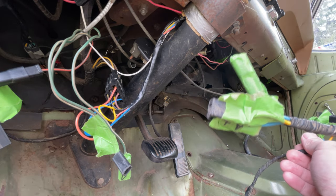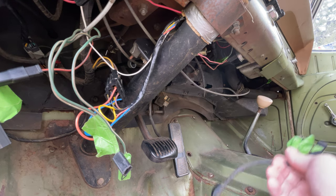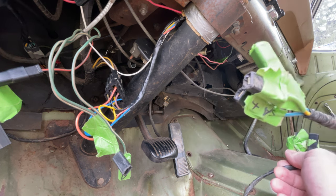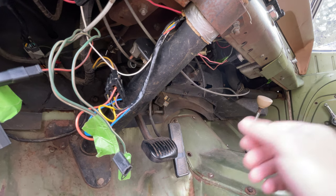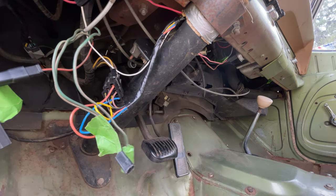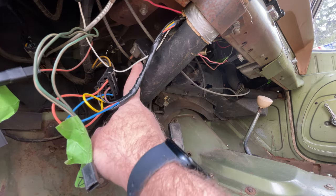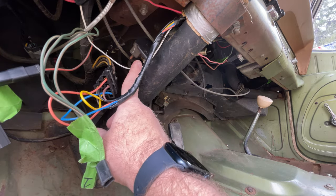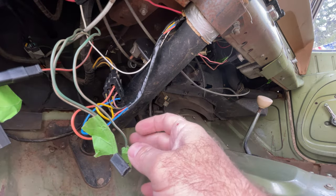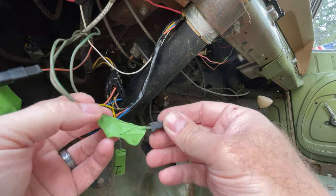I can test all that - put it all together and test it - but I think that's how it's going to work. I've tested each circuit individually, so I have a feeling once I put the wiring in place and quit jumping wires around it'll probably be fine. The other question I had is this also controls the backup lights, so these little blade terminals - probably can't see them - but this controls the backup lights. There's one on each side, and the same thing: when it's in reverse it should send power through that circuit, any other time it doesn't do anything. We've determined this is the backup light.